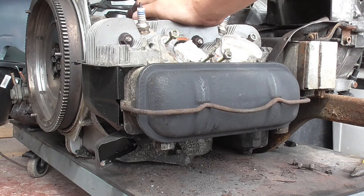I've been setting the valve adjustments this week for the 2 litre CU engine I'm building or putting together for the van. Unfortunately when I got to number three cylinder I found what I think is a stuck hydraulic tappet, so that's what we're going to be investigating today — stripping down and hopefully fixing.